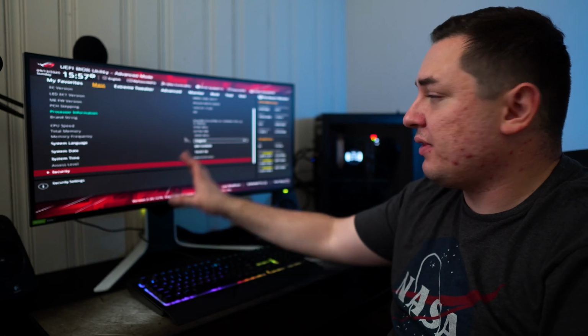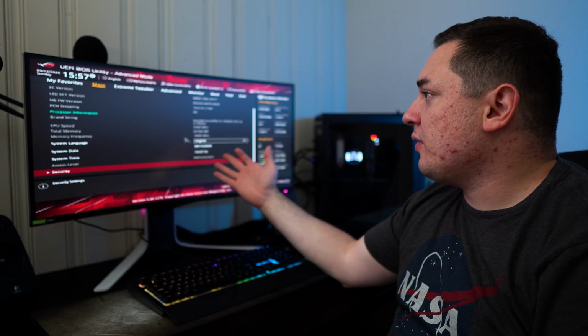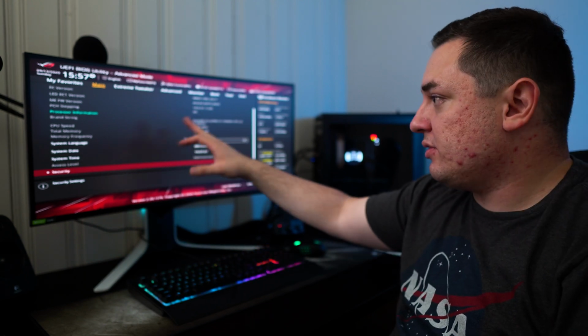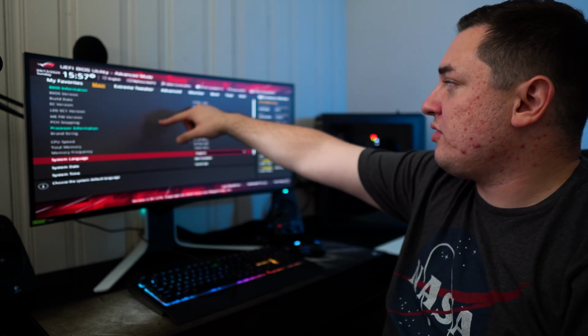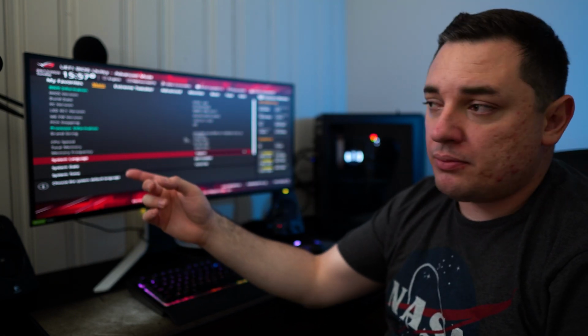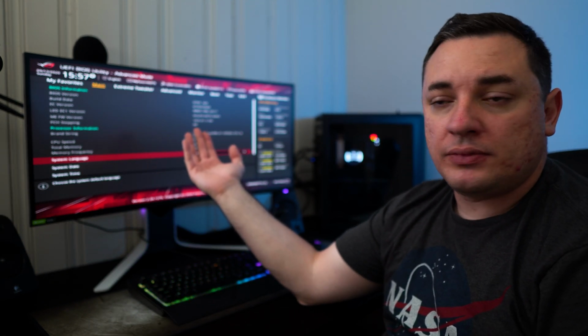All right, we are now in the BIOS, guys. So I'm just going to go ahead and walk through a couple things with you guys. Anybody that's new to like being in the BIOS, it's not really that scary. It's actually really, really easy to figure out what you're doing. So this is just showing me like all the versions that my BIOS is, and so on and so forth, system languages, time, that kind of thing. So at the very, very top, it says BIOS version right here. I have 0704 x64. The version I just downloaded, I think, is a newer 08, I believe. So I'll go ahead and install that, and yeah, I'll show you guys what to do.